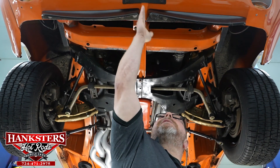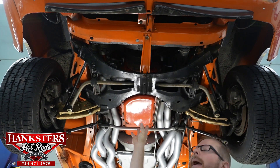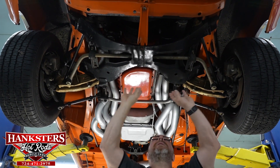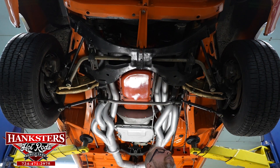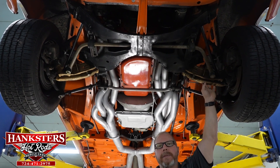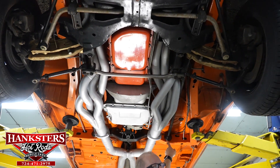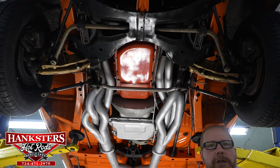It's got a nice split-look front lower valance. Coming back on our Mopars, the Challenger has what they call the K member underneath here — this is an important part because all of your suspension basically mounts off of that K member. This one is in really good shape, nice and straight all the way across. As far as the front suspension goes, it's your stock standard OE-style control arms, tops and bottoms. On the Challenger in particular, you've got the strut rod front suspension with the forward-facing strut rods. You also have the torsion bars that go back here too. All of the rubbers, all of the bushings, everything is in good shape and nice and straight.